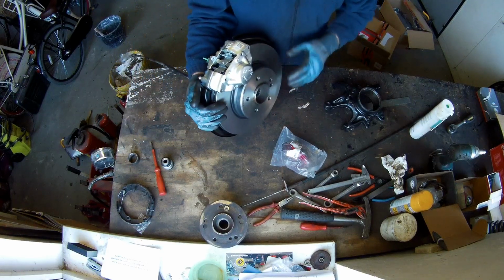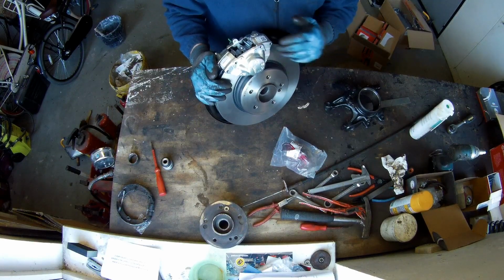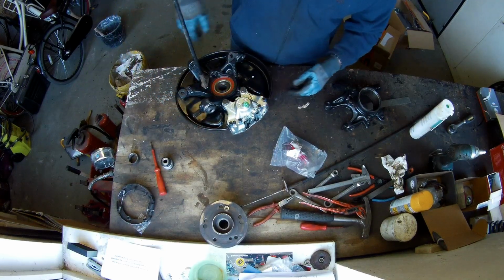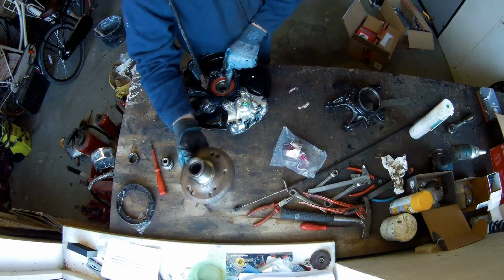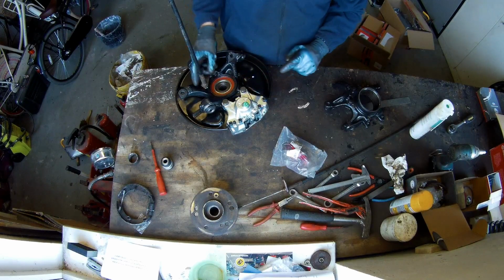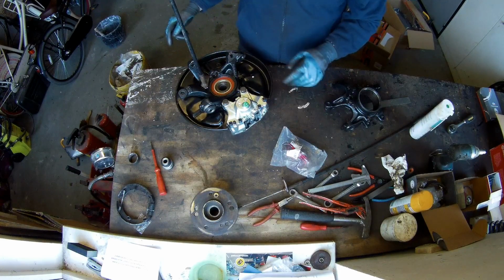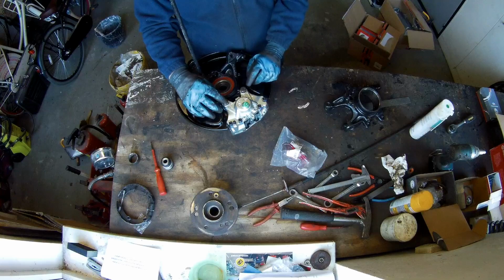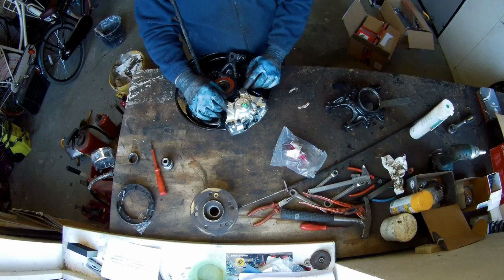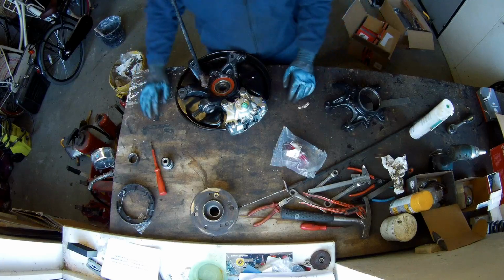So as you can see, this is the complete assembled one. Disc brakes, the handbrake system is in there. You can see the bearing flange pushed in completely, and the cable is an old one. I need to get the rust off this piece, but I do that later on. Two bolts are not tightened yet because I cannot hold it and tighten it. These bolts are M12, and need to be tightened to 123 Newton meters. I will do that when they are on the subframe complete.